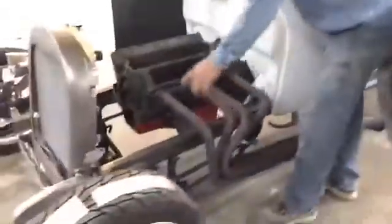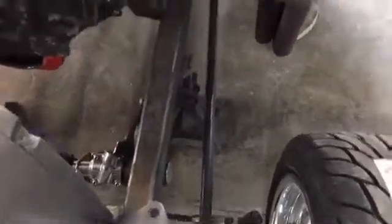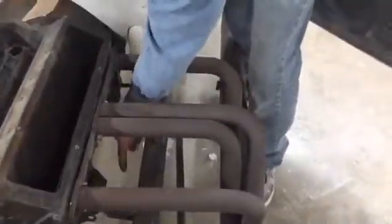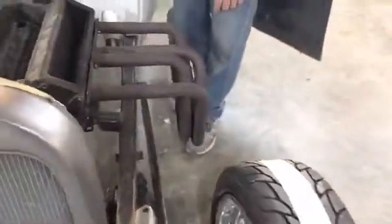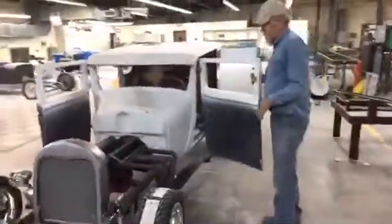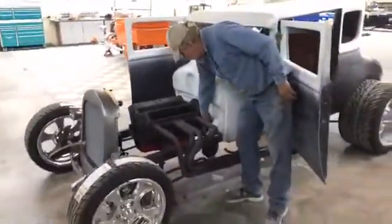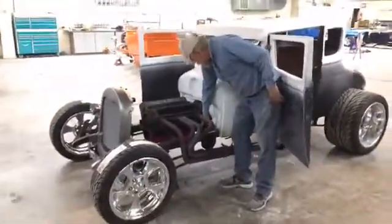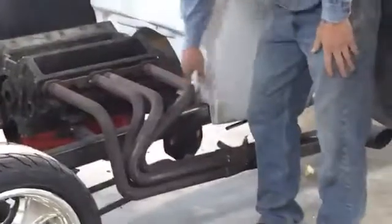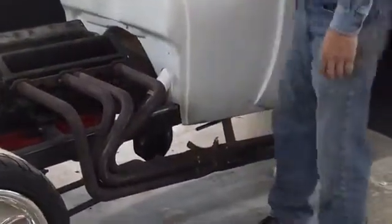I'll be able to use 2 joints, one on the box. Down on the rack here, I can come up with a joint, come across with a joint here, and just a DD shaft going across. It's going to be real simple. Sometimes you have to come around and get around, say, your motor mounts, or once in a while you'll need to worry a little bit about clearing your oil filters and the side of the engine, but we've cleared everything. It came through nice and clean.